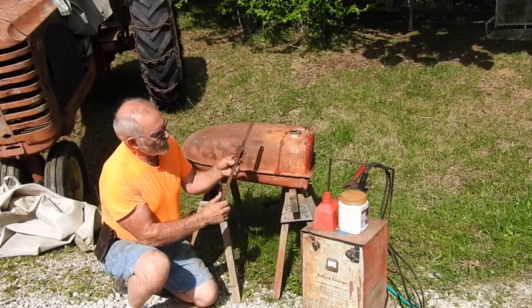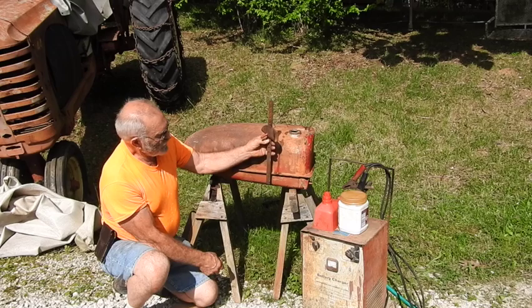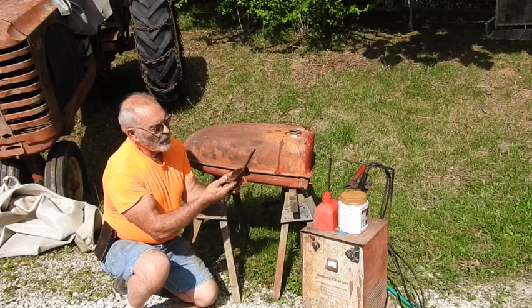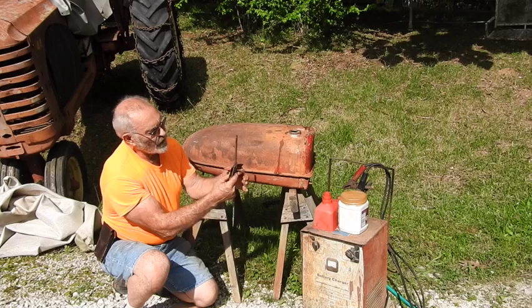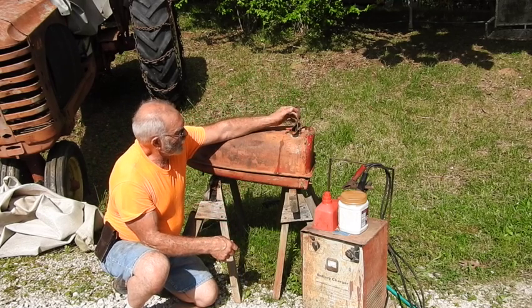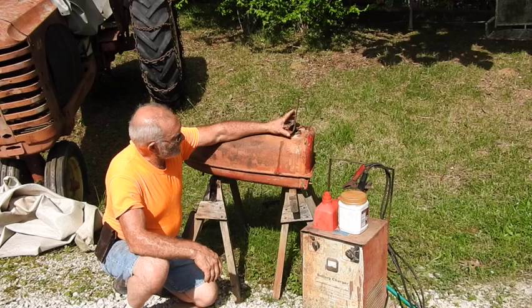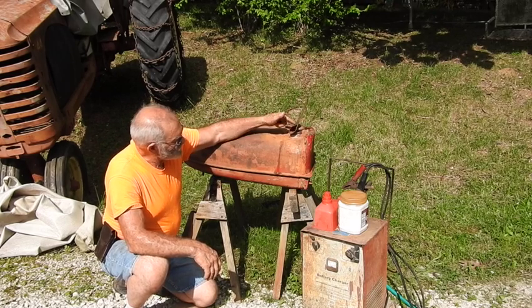I just drilled a series of holes here because you don't know how deep your gas tank is. You want to drop this thing in until it thumps on the bottom, then raise it back up about an inch or so, and stick a nail across one of your holes. Then put a piece of rubber — just an inner tube for a gasket — and secure it with a nail through that inner tube to keep it from shorting out. The rubber supports the whole affair on the neck of the gas tank and chances are it's not going to ever reach far enough to short the other side.